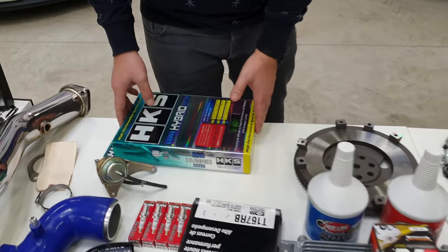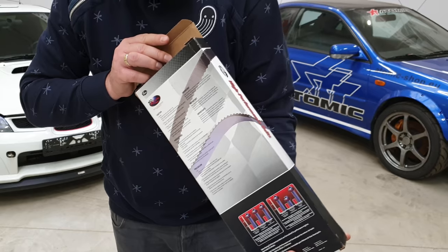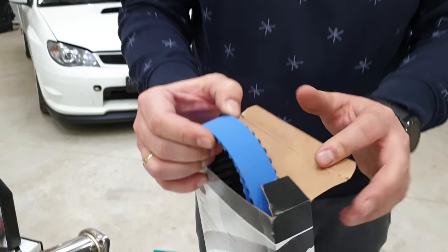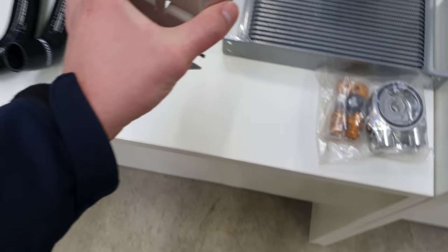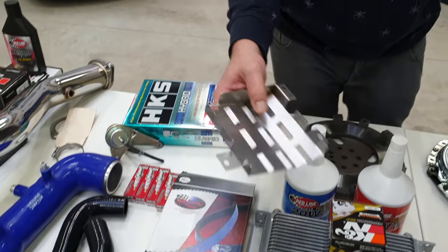The up pipe from the manifold — that's what a lot of people deal with. Make sure your filters are good and new. Your timing belt: it's better to have it from Gates Racing because it's reinforced with Kevlar and other things so it's much more bulletproof. The normal one is basically nothing special, but make sure if you have OEM stuff it's in good condition.